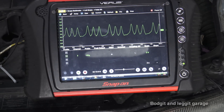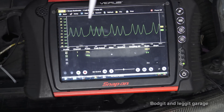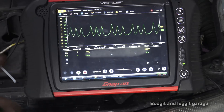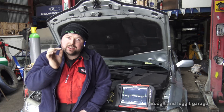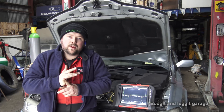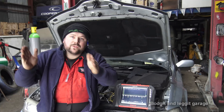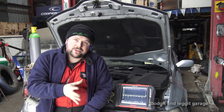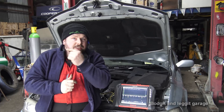I'm going to put a second channel up connected to an actual coil pack — I've picked number three cylinder. Even without this we can identify the dead cylinder because we took out number one, but this is a way of positively identifying it. Bear in mind this is a wasted spark system, so two coils fire together — you're going to see two firing events. I'll save the detail for another video but we can still work out where we are from the spark plug we've taken out.